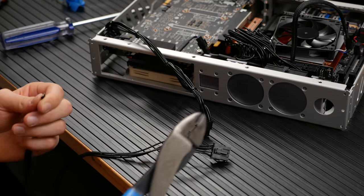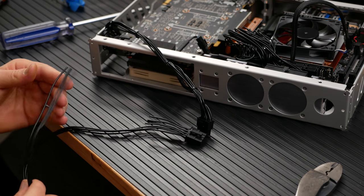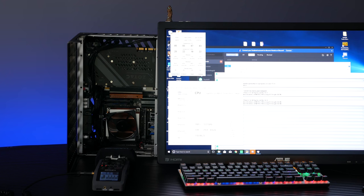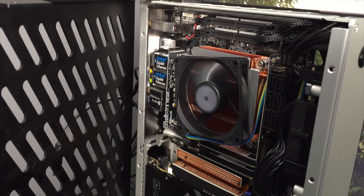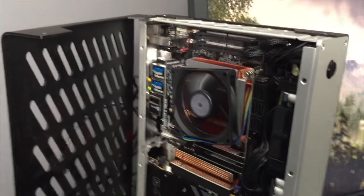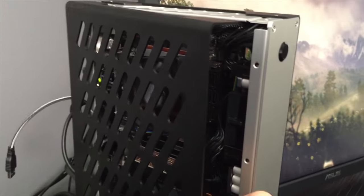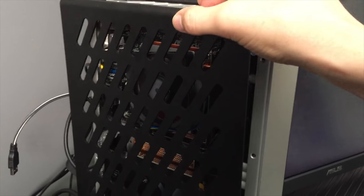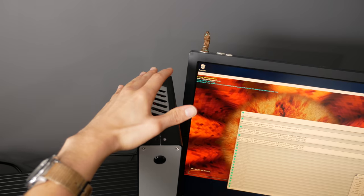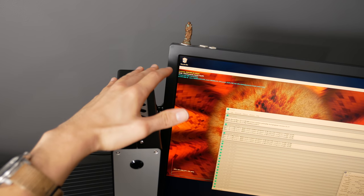This was thanks to the new Skyreach 4 Mini, which I chose over the S4 Mini Classic because I needed as much venting as possible. I quickly found out that the coolest orientation was 180 degrees out from the S4MC, with the GPU at the bottom. I also discovered that the ASRock X299 ITX will boot with RAM in any of its four slots, which let me leave two blanks so we could have hot air exit the CPU cooler and vent out the top.